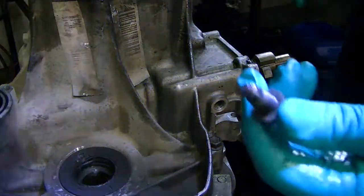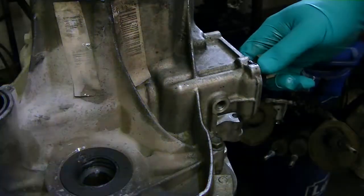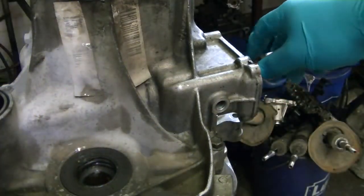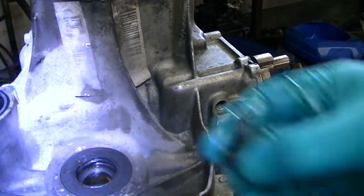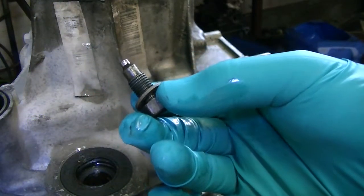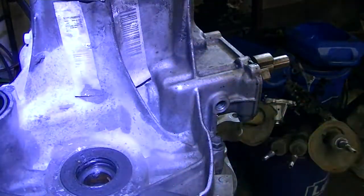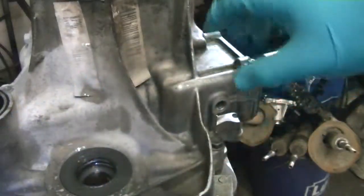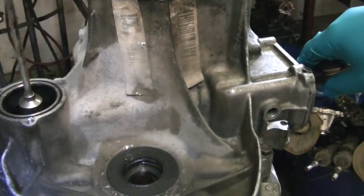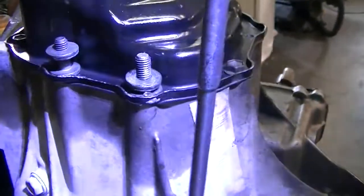You've got a 14mm bolt here on the side of the case that pins your shift selector rod in. You're just going to take that loose — that's going to point to the firewall on the car. You simply pull it out; you have to keep this washer, so don't lose it. If you lose it, it'll lock the shifter up tight. It's actually a shim that stops the tip from pinning it down, and you're just going to slide it back just a smidge.